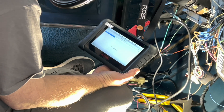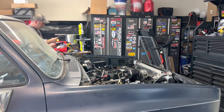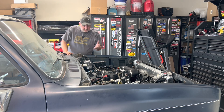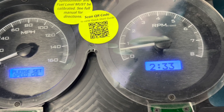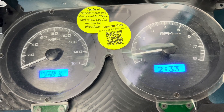It's scanning, it's communicating — that's a good sign. Turns out the problem was I didn't have the power wire hooked up to the truck module. Imagine that. Anyway, I got it running again and it idles exactly where it should. Look — right around 700 RPMs, right where it should be. That's awesome.